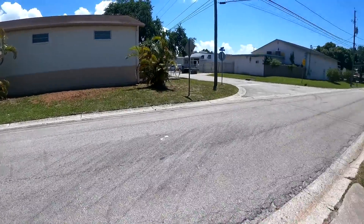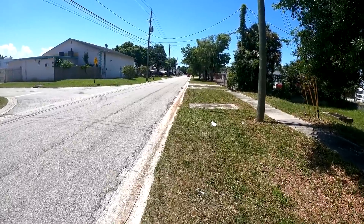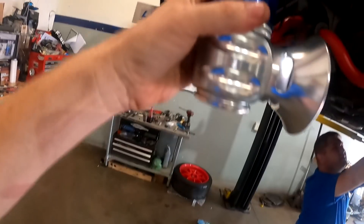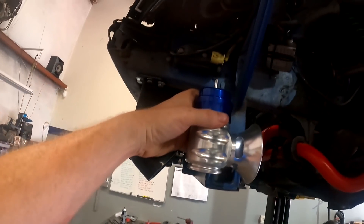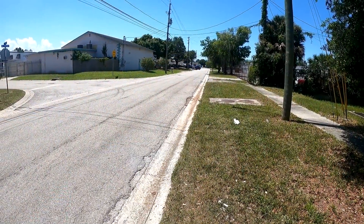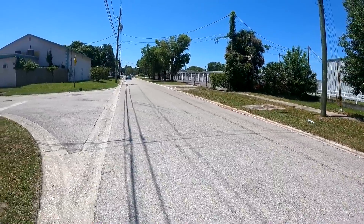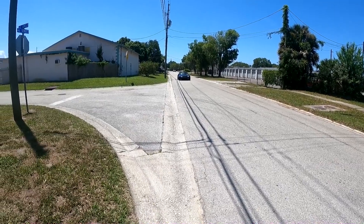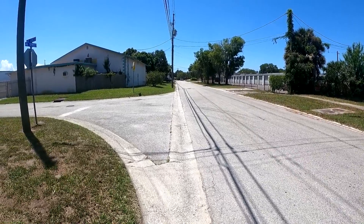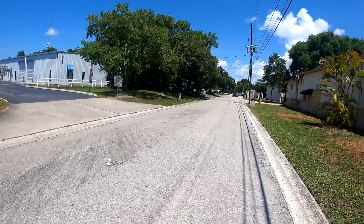It has the valve hooked up correctly from Craftworks — it has the bypass valve, the billet — and it also has the Bubba Sonic as well. In the event it gets kind of annoying, it can be unplugged, plug the hose, and the valve will work conventionally. The Bubba Sonic will just sit there. Build the car the way you want it, not the way your friend wants it. Keep in mind the supercharger makes boost all the time.